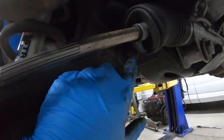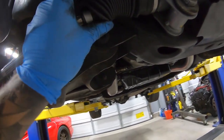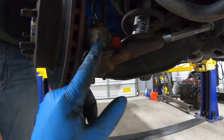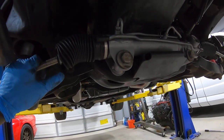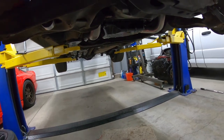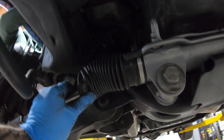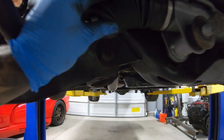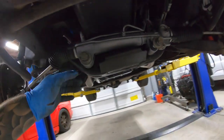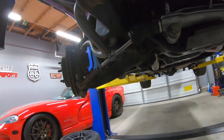I'm realizing this bolt for the lower control arm is going to be in the way of the steering rack, so I don't think I can manipulate it. We're going to have to take this off to be able to articulate it out of the way - I don't want to remove the whole rack. I think we could pull out one bolt in the rack to loosen it. That ended up being the easier way for sure - I just popped off these two bolts with the gun and now I can get clear access to the bolt. We'll do the same thing on the other side, turning the wheels and moving the steering rack just a tiny bit.